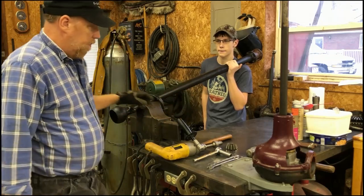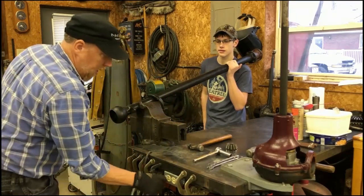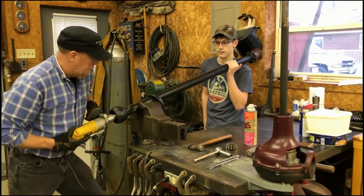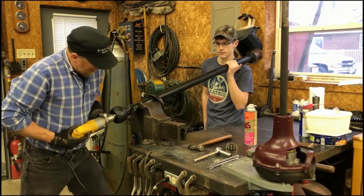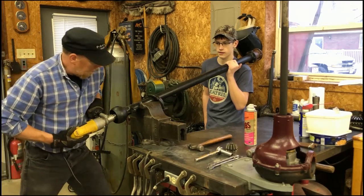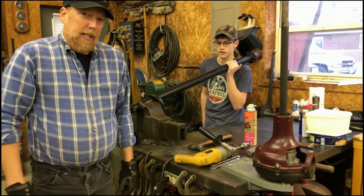So we've got to face off a little bit more on this bushing up here to get the U-joint to fit. We're using this tool here — this is actually made to do this job. And once again, this tool is available through the antique vendors that sell Model A and Model T parts. I didn't have very much to go — I didn't really need to take off a lot. This tool is really made to be used by hand; I'm kind of using machine work here, so I'm trying to take it easy. It looks like we're okay.